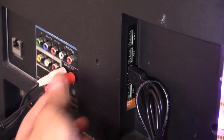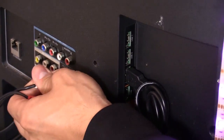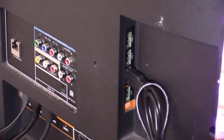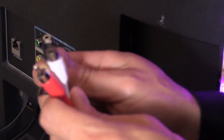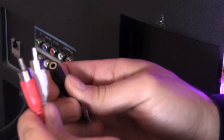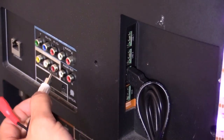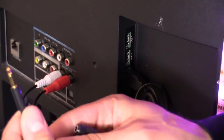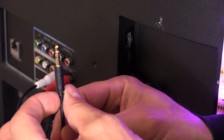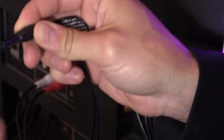I have my amplifier connected to the audio output on my TV — it says 'Audio Output.' I'm going to disconnect that and connect this Y-adapter, which comes with the Avantree kit. This is an RCA to 3.5 millimeter jack adapter. Connect to the audio output — white goes to white, red goes to red — then plug in the included 3.5 millimeter audio cable.